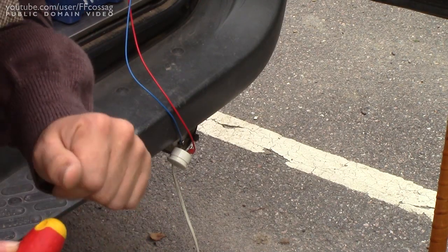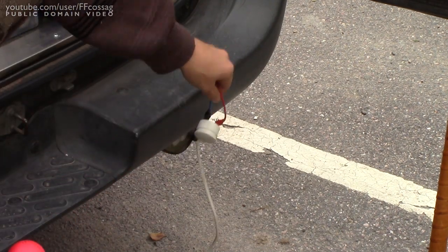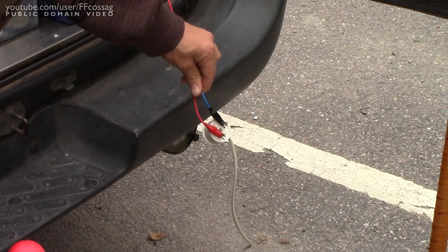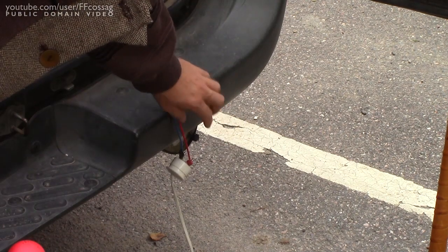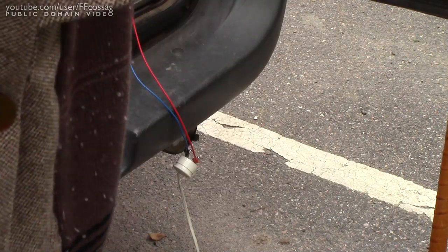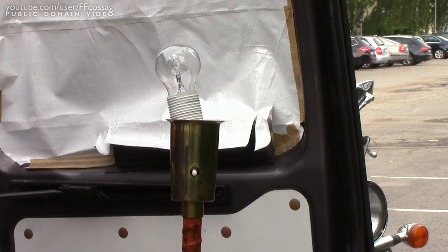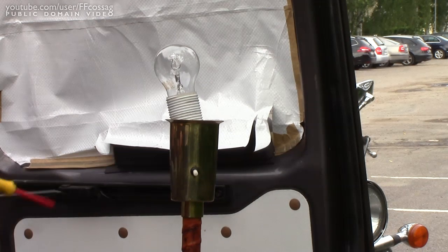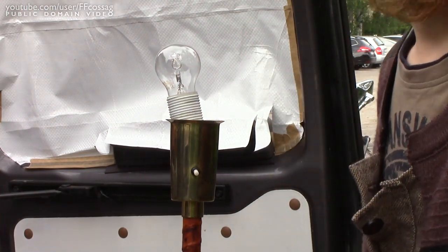I gave it a big dose of isopropyl alcohol and we're ready to test it. I noticed that since this has one of these ancient ungrounded plugs, it won't fit straight into the inverter, so I had to use a couple of test leads to just jury-rig it up. It's plastic, so there shouldn't be any electrical danger. Inverter on... yeah, it's gonna need a new switch. Oh well.